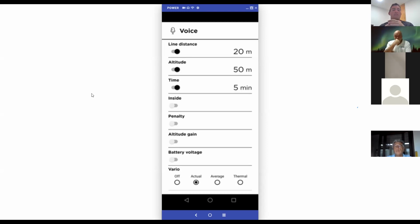No, these voice announcements are not controlled by time, but they are controlled by the origin and margin around these 20 meters. That means if you are not flying slowly out, but you are flying like 60-degree or 90-degree out, you can miss some of the intervals, basically when flying a bigger plane or moving faster, because this voice announcement will be set at 20 meters plus minus 3 meters.